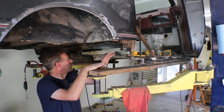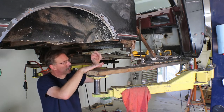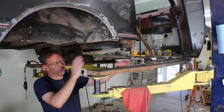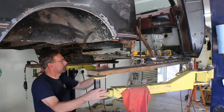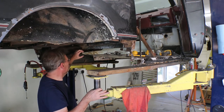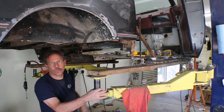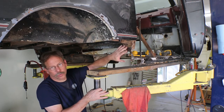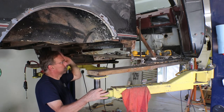I've gone pretty much full tilt on this. The inner rocker had a couple places that were rusted through at the top, so I was starting to cut out rectangles — and then I just said, you know what, I'll just cut it off and make a whole new piece. That'll be one of the first pieces we make: the inner rocker with two bends and about 16 to 18 inches of material. Then I'll build up this body mount area and the floor, and kind of fill in the corner again. Most of these are smaller pieces — I'm not going to worry about the bolted connections; I'm just going to weld everything in, and then reattach the rib that would have been in here, since there's nothing wrong with it and we took it off so it could be reused.